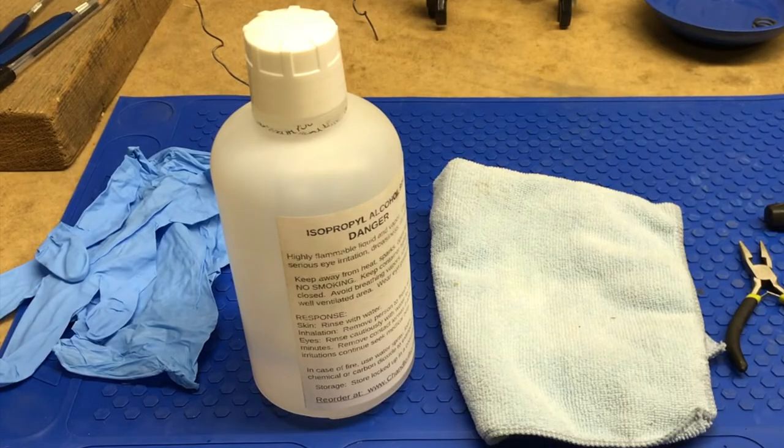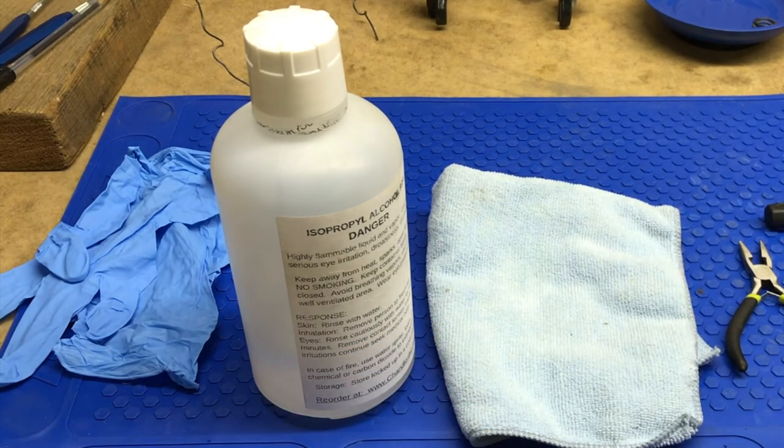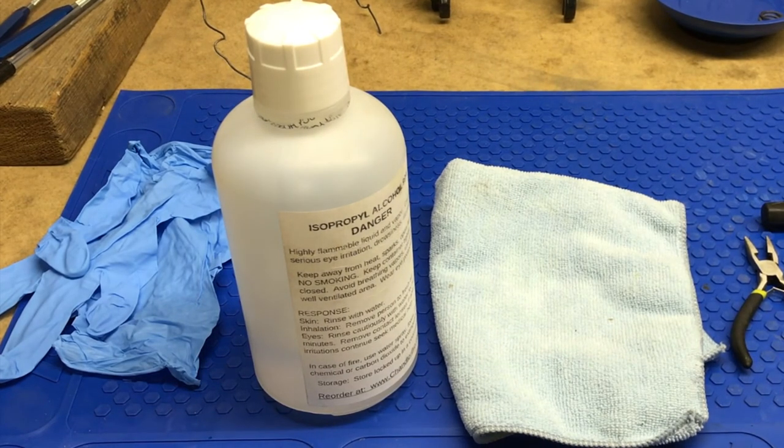That other approach could be cleaning disc brakes. When you do this, you want to clean the pads and the rotors. I like to use rubbing alcohol on my pads and rotors, but you could use disc brake cleaner. I've got rubber gloves to protect my hands, but mostly to keep the oils from my skin from getting onto the brake pads or the rotors. I've got isopropyl alcohol that I use with a microfiber towel to clean the pads and the rotors. If you don't have these, you can probably borrow from a friend.